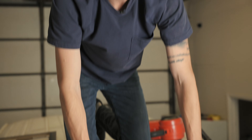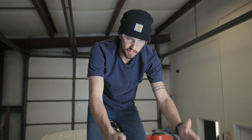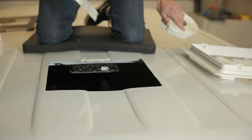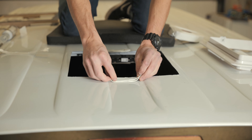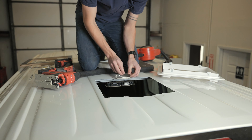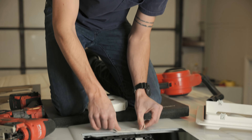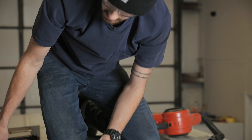We want to make sure the screw holes for the fan are on the sides so the fan sits front to back nicely. Now that the flange fits, we're going to butyl tape around this ridge. Butyl tape is basically like a caulk or sealant but it holds some dimension. In these grooves that sit lower than the ridges, we'll double wrap and build up those areas so it all sits nice and flush. Pack it down in there, go around the outside, and then we'll flex shot around the outside once the fan is in.